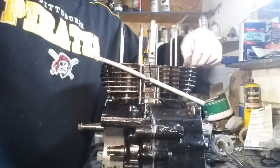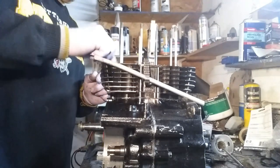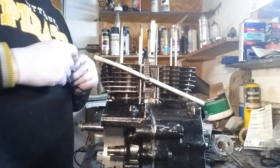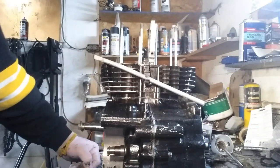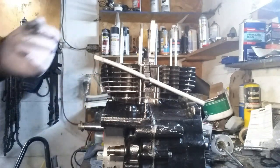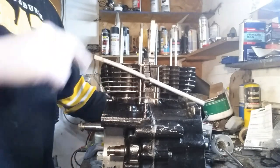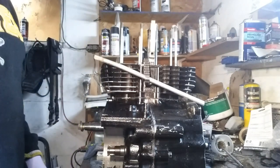All right, we're cleaning this with acetone. After you get your gasket scraped off, these surfaces — what I do is I use a Dremel tool, I have this little disc here, and I sand it down where it's in really good shape. I actually did this before so that should be fine. And once again on top here too — you have dowel pins, we'll put those in the cylinder head before we drop it down.